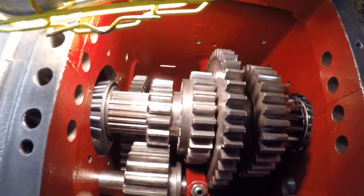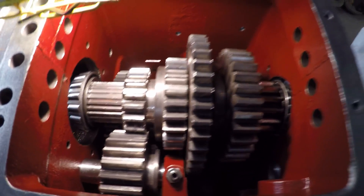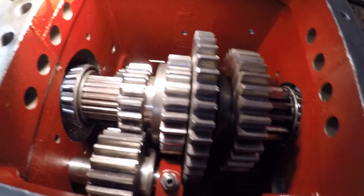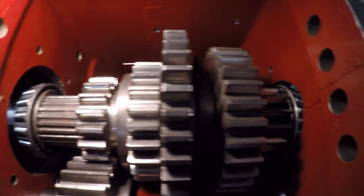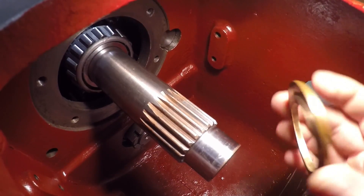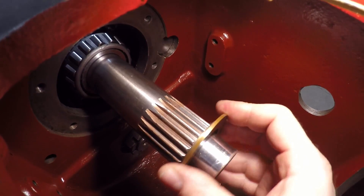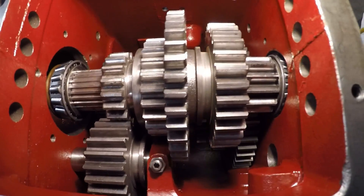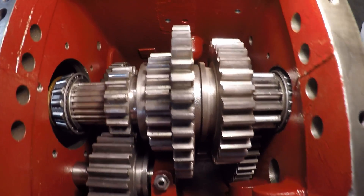My home-built installer tool works so well to press that front bearing on that I turned it around and pressed the rear bearing onto the shaft with it as well. I literally had about five minutes invested in seating both bearings where they needed to be. I spent a couple hours making the tool, but it's totally worth having the right equipment to get those seated without hammering, forcing, or damaging anything — just the way I like to do it. The final piece to go on this upper sliding gear shaft is the front thrust washer — pretty simple installation, it just slides on and goes up against that front bearing.